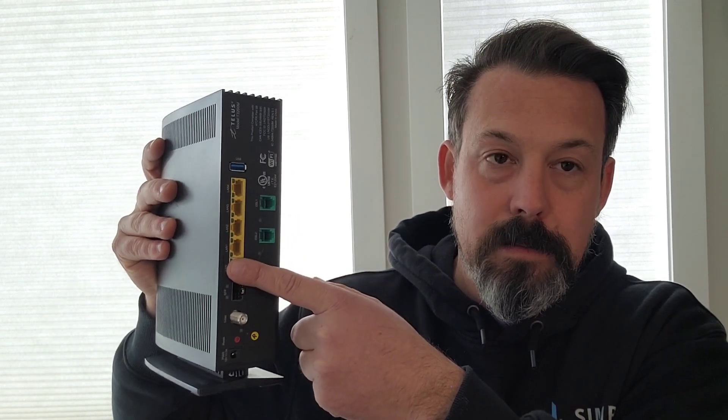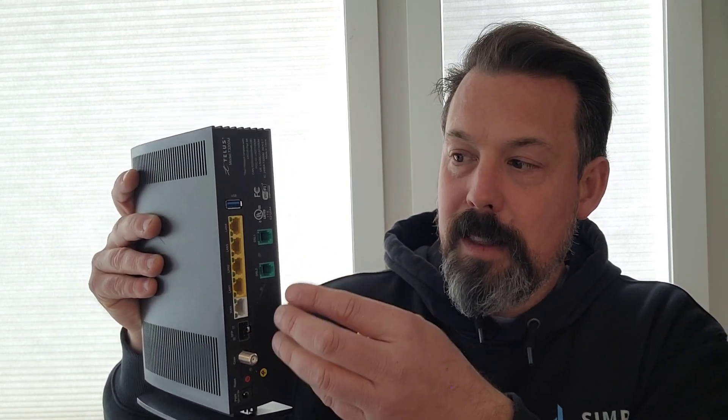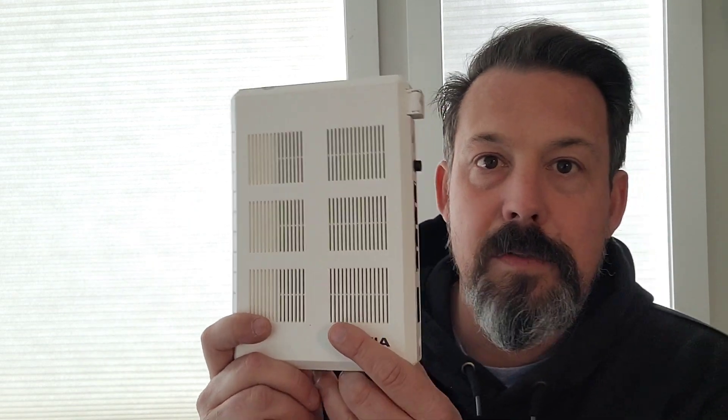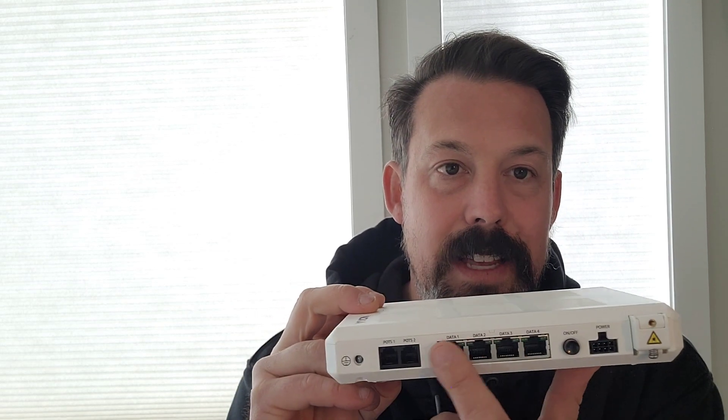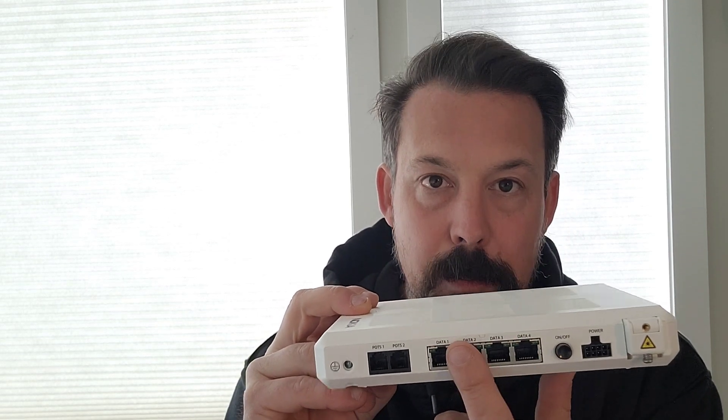The easiest way to do it would be to plug it in directly. Your router will have a WAN port — that's the input, and the other ports are the outputs. Your WAN port has to get an IP address from something. So if you've got an ONT, it's screwed to the wall, the fiber's in there, it's turned on and working. These are your phone ports, and one of the data ports will be provisioned — most likely data one. If it's plugged into something that's not provisioned, the lights won't come on when your router's connected to it.